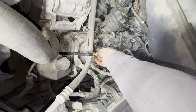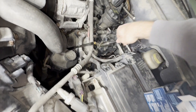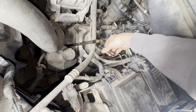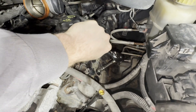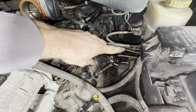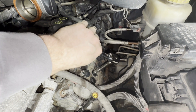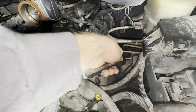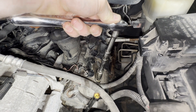Take the plug and let it slide down into the hole, then take your socket, sit it on there, and spin it until it starts to get semi-tight. Once you feel it bottom out, put your ratchet on and tighten it up. You don't need to get crazy tight — the German method is good here, which is guten tight. Now repeat the process for your other spark plug.